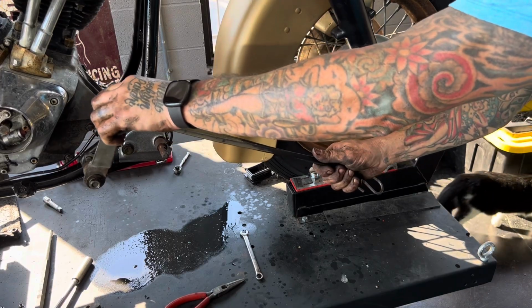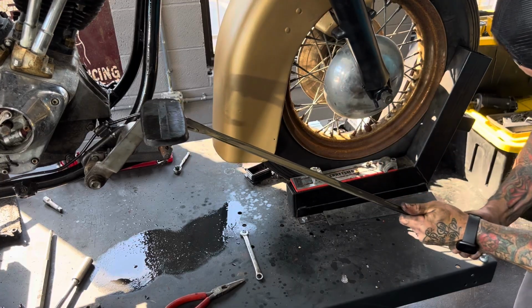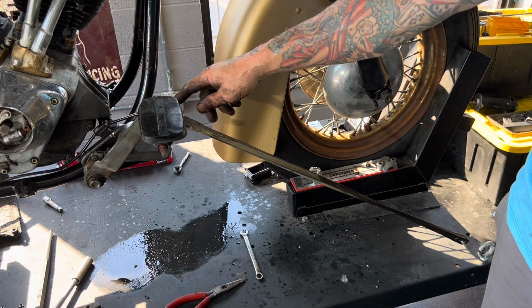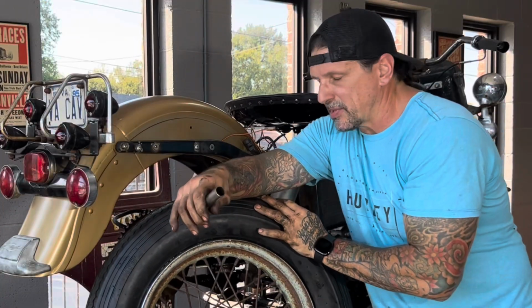Pump. And usually give it 3 good pumps. Then tie the bungee cord down. And the bungee cord is just like your foot on a pedal, pressing down, keeping the pressure on the master cylinder until you release the pressure at the wheel cylinder. I know the business with the rear brake is done.